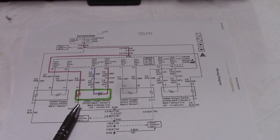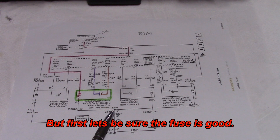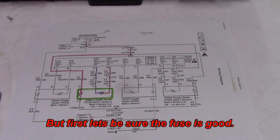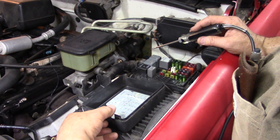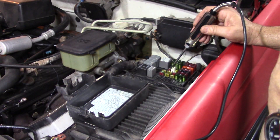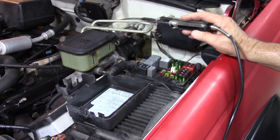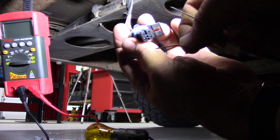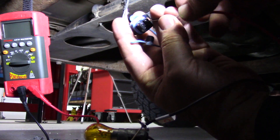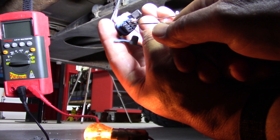What we need to do is find the pink wire with our test light and make sure it has battery voltage and can carry a load — carry current. We're going to hook up to black and pink and see if we have capability of power in that unit. It says under-hood fuse block, engine one. The closest I can see is ECM one, but I checked all the 20-amp fuses and they're all good. We should have power down to the O2 sensor. These two top pins are my pink and black — we're carrying about 1.6 amps.